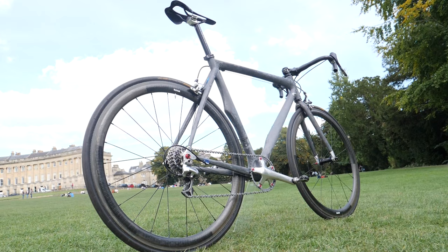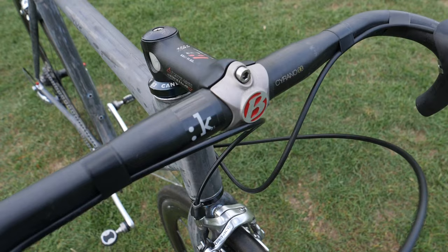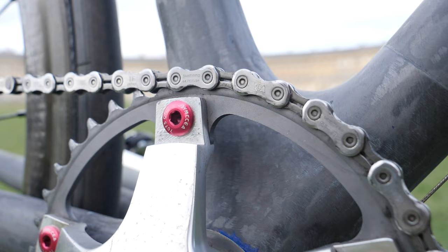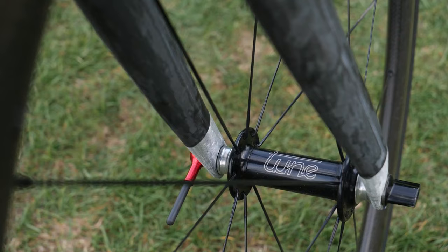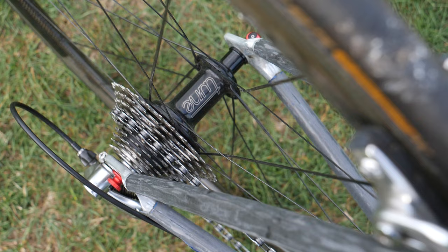Before we get far and go ride this bike, a few things I want to cover off. Firstly, I think it looks absolutely incredible — I'm super chuffed with how this thing came out. For anyone ready to comment that it's super light because I've just removed half the useful stuff and chopped off the handlebars — I've already taken that into account. By adding back on the large chainring, the front derailleur, the bottle cages, and some normal handlebars, I've added up the weight of those components. It comes to 500 grams, which means adding 500 grams onto the bike weight of 6.22 kilograms gives us 6.72 kilograms — still under the UCI's weight limit and still an incredibly light bike.